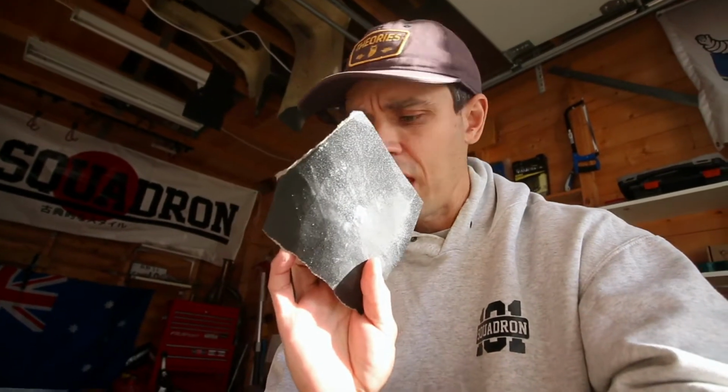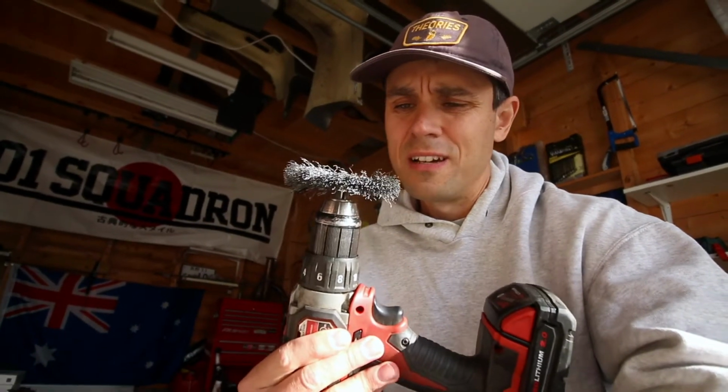So what I was thinking was just giving it a bit of a sand and using a bit of alloy polish here, and really making it sparkle, I guess. I had thought to paint it, but I'm kind of leaning against doing that now. Really because I don't know how much the paint will last, and if it starts to peel, it's just going to look ugly. Just say if I hit it with a high pressure hose or something, the paint will just come right off. But I've had a lot of success with doing things like this before, with just using this Autosol polish, a little bit of sandpaper, and for some other areas then using the wire brush wheel on the drill. So that's what we'll do now.